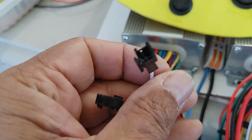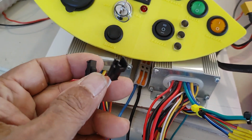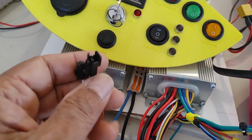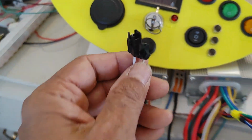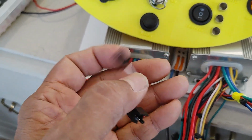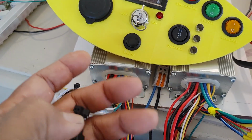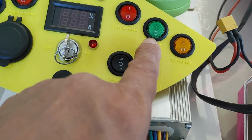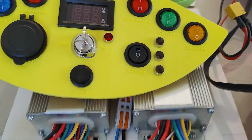This also learns the orientation or rotation of the motor when you first start up the unit. So when you first start up, if the motor's not running in the right direction, you switch this momentarily and you disconnect, and it'll reverse it, and then it'll be reversed from that point on, until you do this again with the switch, so this will be connected to that for reverse